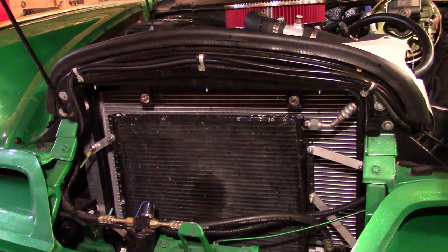The first thing you need to check is your radiator — make sure it's in good condition. Originally this car came with a downflow, but what I've done is put in a crossflow. The original radiator was only 26 inches wide and about 21 inches tall tank to tank, but the crossflow I opted for is 19 inches tall and 31 inches wide. You have to do a little alteration to get that to fit, but make sure you have enough radiator in good condition for the type of engine you're running.